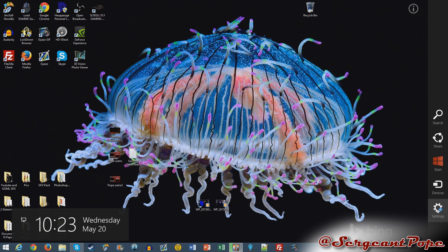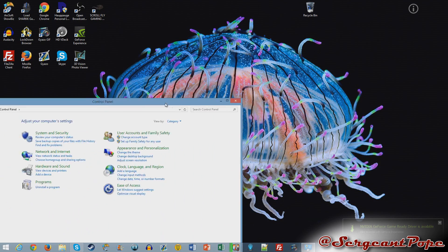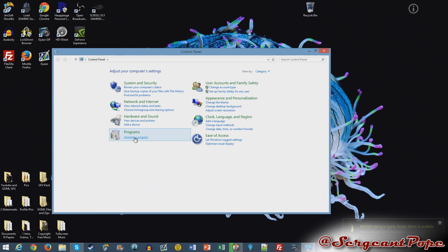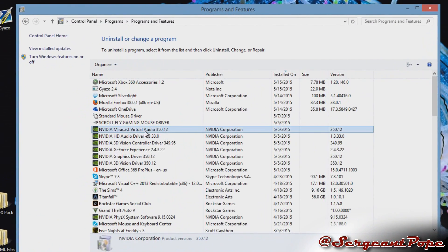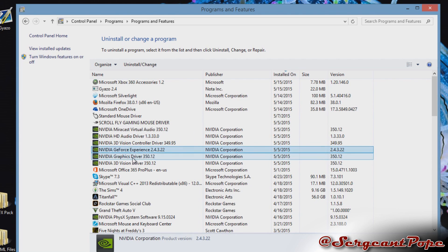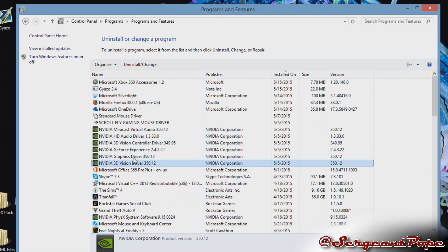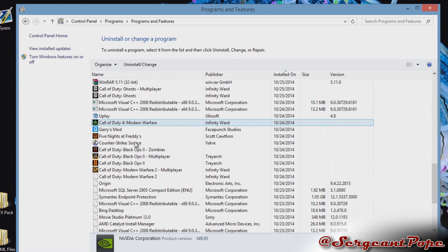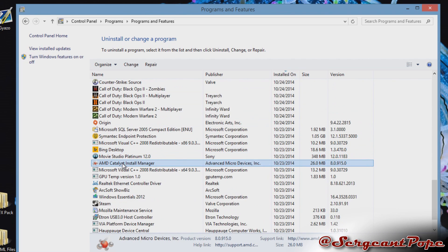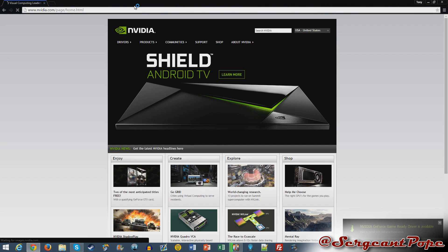At this point, it's time to uninstall your old graphics card drivers and install your new ones. To uninstall programs, go to Control Panel and then 'Uninstall a Program,' and find your graphics card drivers — most likely listed as AMD, Intel, or Nvidia. Just uninstall those drivers. Once you do that, the screen will probably look really bad, because there are no drivers installed — the drivers are what make the screen look proper. After uninstalling, you might have to restart your computer.